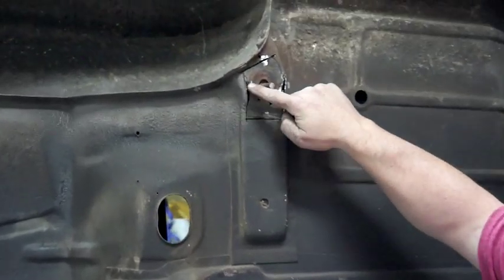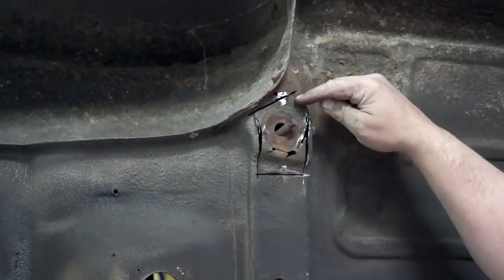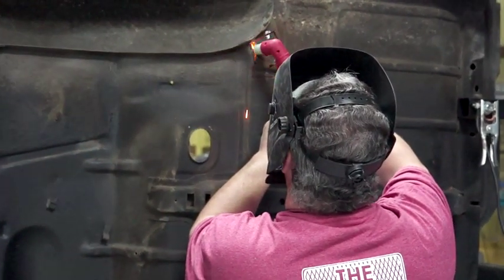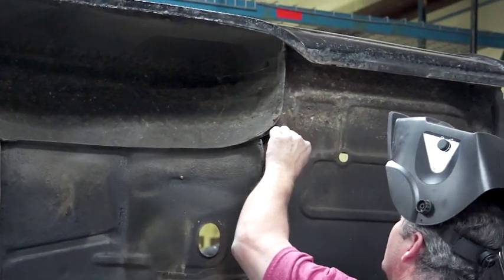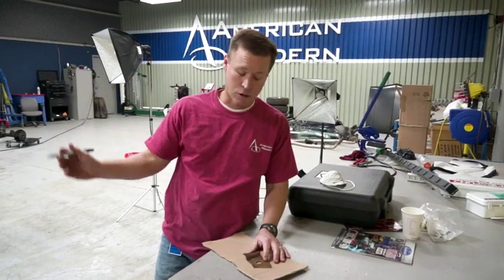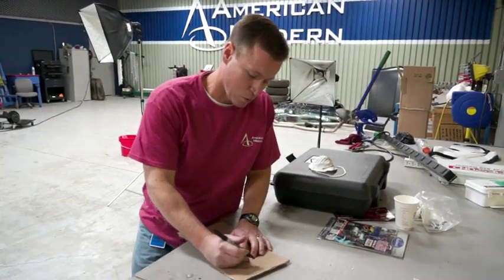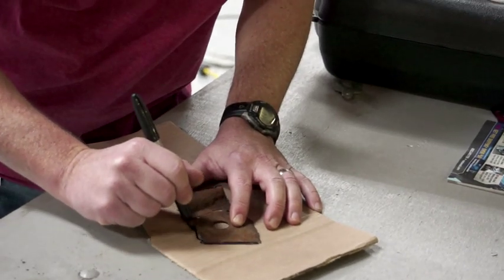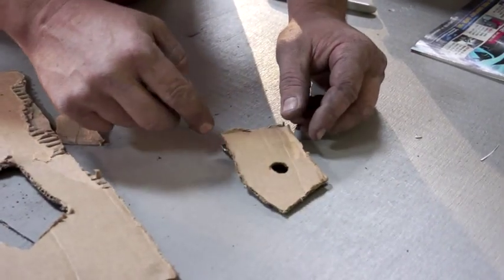We've got the cut started down here all the way around. We can't cut here because the whiz wheel will go right through this lip and we want to keep that intact — same thing here. We might be able to cut that, but this little piece right here we're going to cut with the plasma cutter. Now that we've cut that off, what we're going to be doing is tracing the outline of it — make a template of it so we can create a new piece of metal to put under there. This is what we cut out, here's the cardboard template, and you can see it fits right over there.